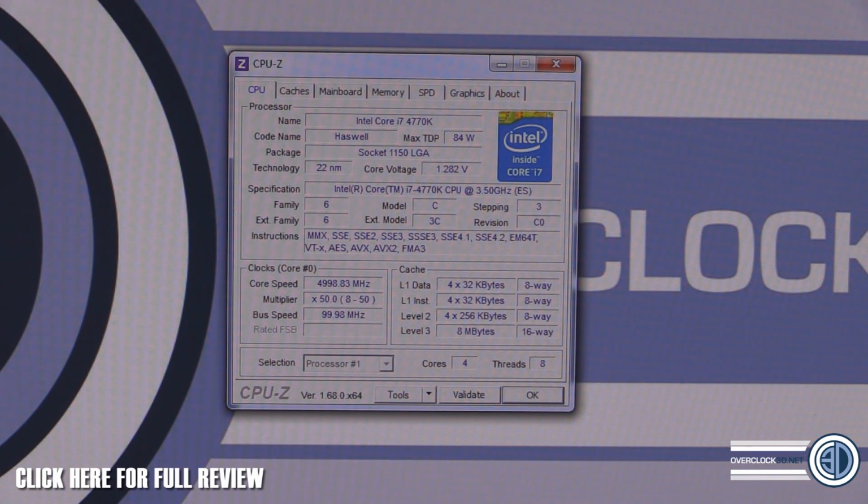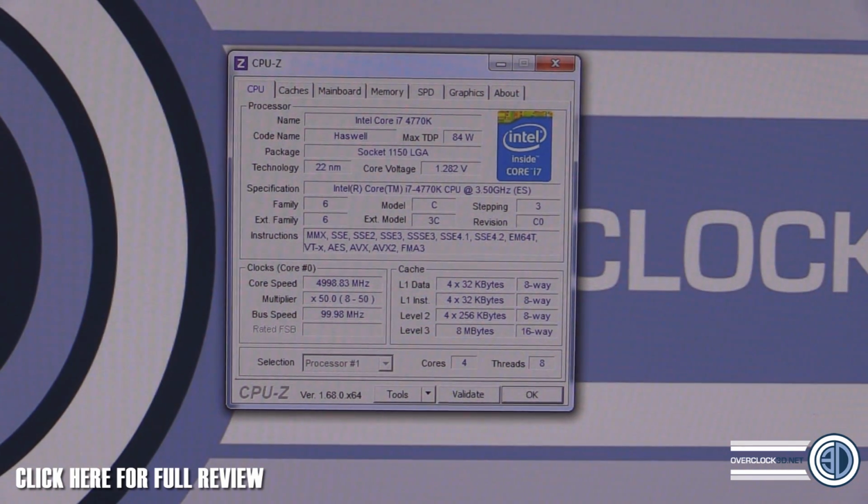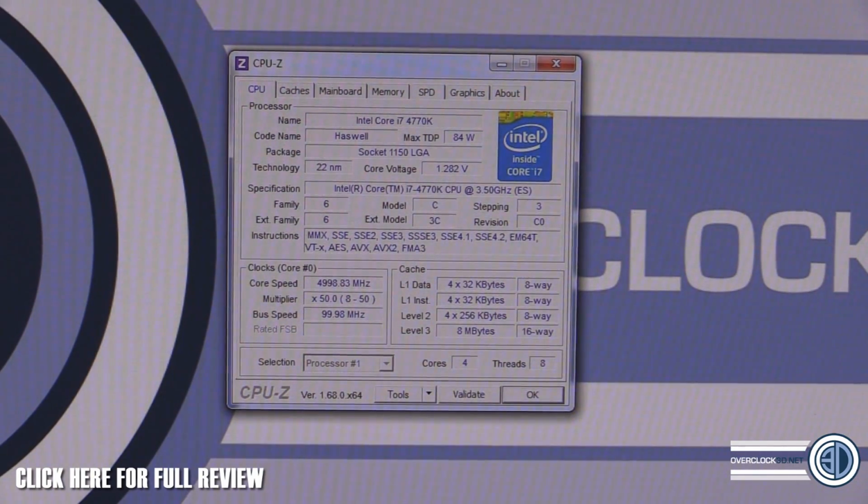The Z97A straight away has managed to get a 5 gigahertz overclock at 1.28 volts. So less than 1.3 volts, which was the point that I normally push to before, and that was always just to try and get a stable, you know, a screenshot. This 1.28 volts, changed it to 50 multiplier, hit F10, booted straight up without any hitches, hardly any changes in the BIOS, and we still managed to get that.